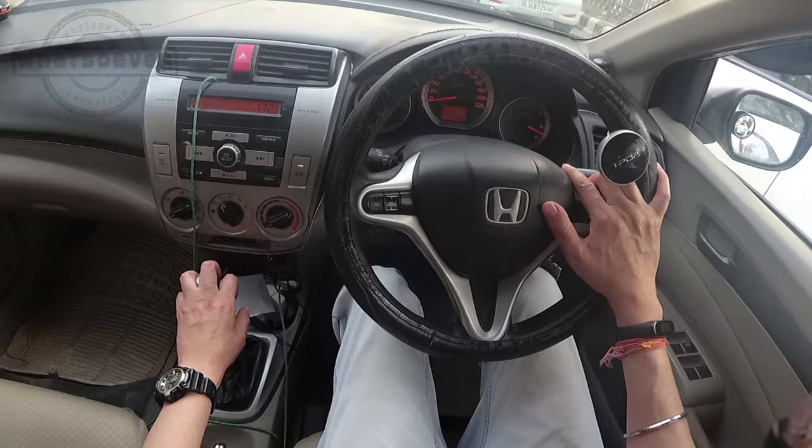So guys, as you have seen the clip, you will hear the sound of the car. I asked my brother, who is at the garage, what the sound was. They told me that the calipers are not working properly — they are sticking. This is why the brake pad was rubbing on the disc. The next day I changed the caliper pins and the disc pad.